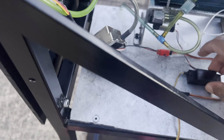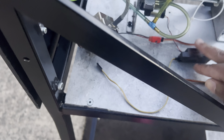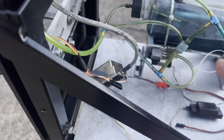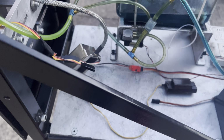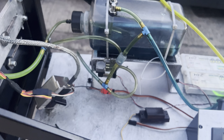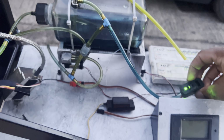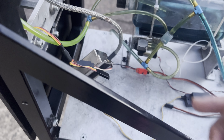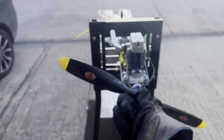I will demonstrate with the engine start, plug it in, give it a good run up, switch it off, try to hand start it again, then unplug it and hand start it and show you what my finding is. So running on 20:1 fuel mix, as you can see, power on. I don't have my digital reading powered up either because it's not plugged into the ignition, but the engine should be ready to go. Starts really easy, the idle is low, so let's give it a turnover, bring it on to compression, and that should actually go there. One more.